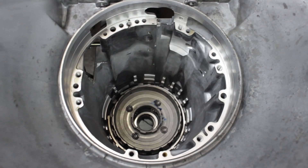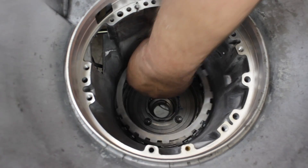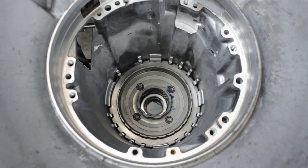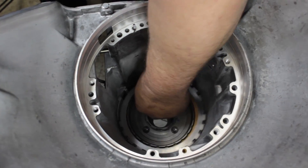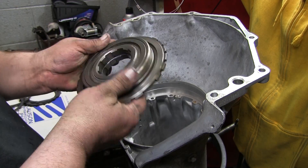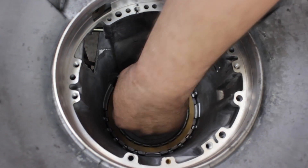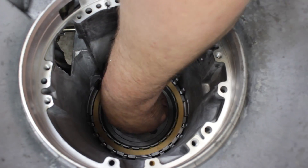At that point it's time for clutches — that's just a wave plate, then the first steel, clutch, steel. These only go in one way. Once all those are in, it's time for the backing plate that also has the sprag in it. The lower reverse sprag turns one way but won't turn the other. Before you put the backing plate in, you've got to put in this anti-clunk spring. You'll see it has a groove right here — just lay that groove on that little bump down there, and that's where that goes.